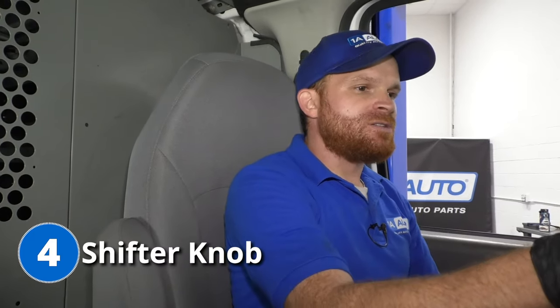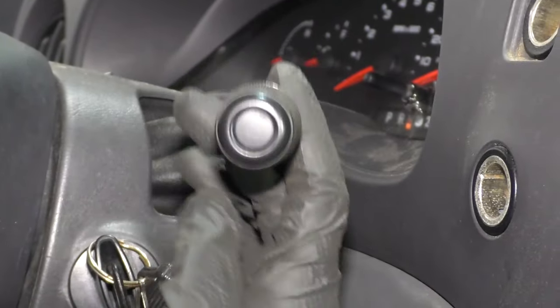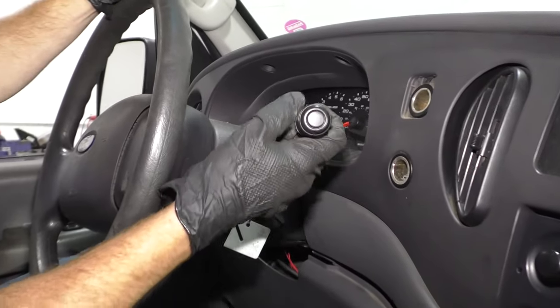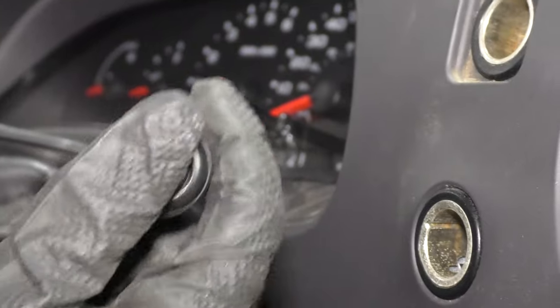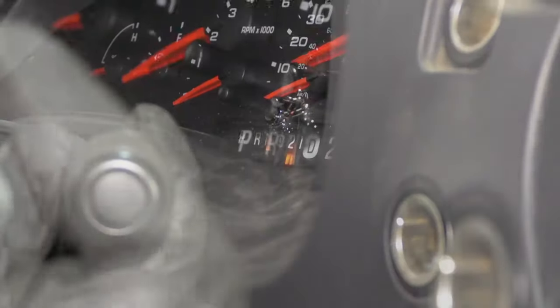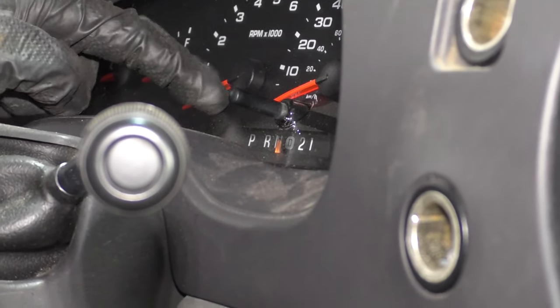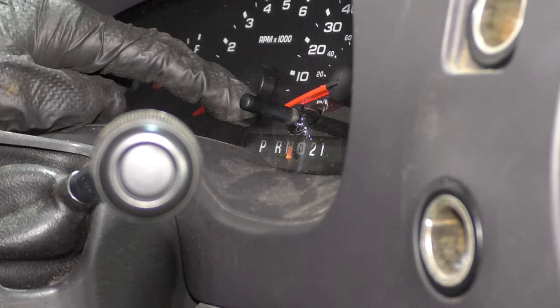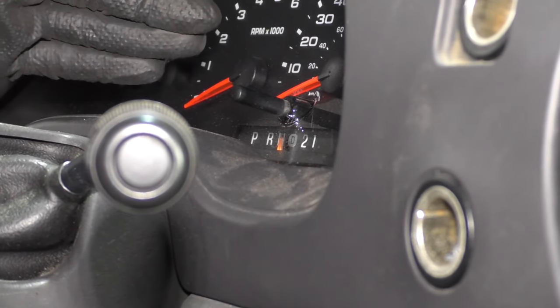The fourth problem on this particular vehicle comes down to the shifter knob. If you look at your steering column, you're going to have this big lever right here and it kind of just wobbles around. This is very common on vehicles that have their shifter attached to the steering column. Some of the symptoms, aside from the wobble you can feel by hand, would also be up at the indicator — as you wobble the shifter, it's kind of going in between gears. In really bad cases, you might think you're in drive but really you're in neutral, or maybe you're actually in second. It could be a safety issue and it's definitely something you want to look into.